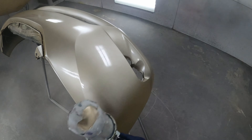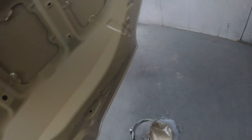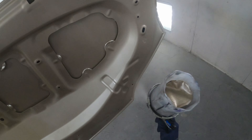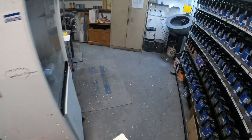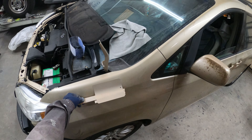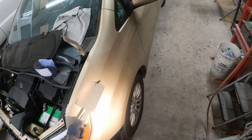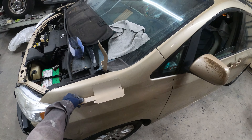That color is a little too light — it's close but a little too light for what I'm doing. Now with the new hood, like if you've watched my videos before, when I'm cutting in the hood I like to spray sealer and one coat of base on the outside and the inside underneath the hood. That color doesn't match — it's not a great match, it's a little bit lighter. I got this color from the camera, used it to take a picture and get the color as close as possible, but as we all know in this paint world that camera is not perfect. Gold is just a really hard color to match anyway.